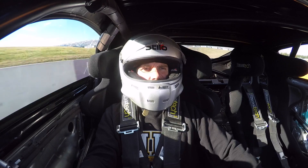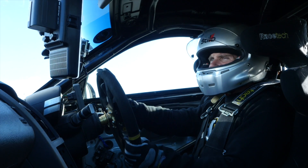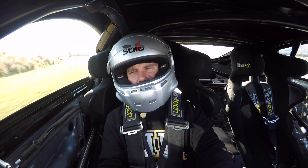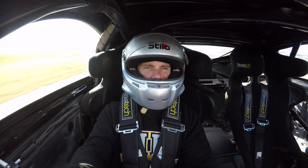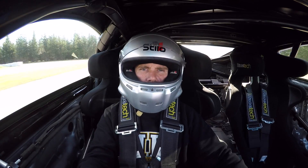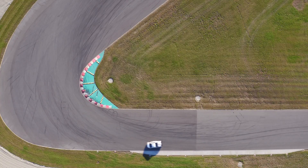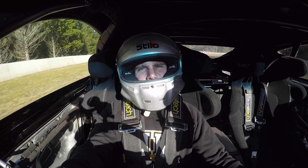The more important thing to note when running these high tyre pressures is that after the car has performed two or three hard laps and we're starting to build a lot more temperature into the tyre, this naturally also increases the amount of pressure in the tyre. Under these conditions, this is where we start to notice that the grip levels can really go away and the car again in the low speed corners can become quite skatey. We get a little bit out of shape. Let's head back into the pits and have a look at the data.